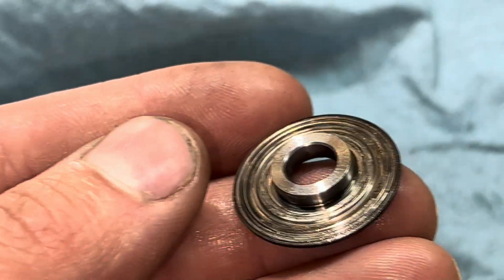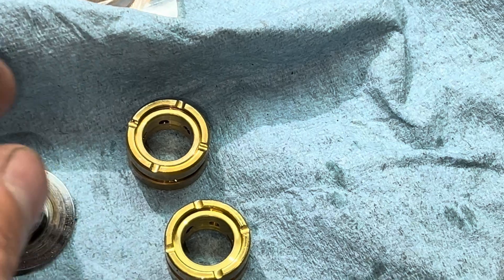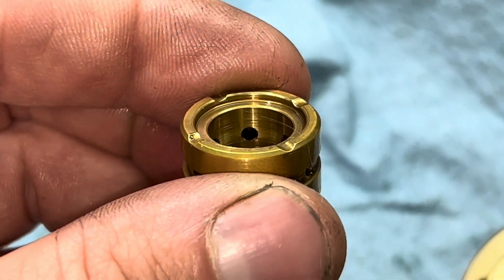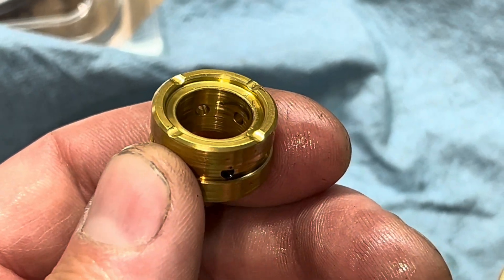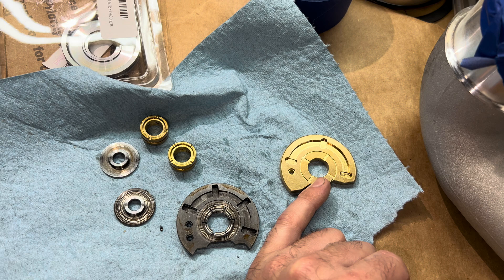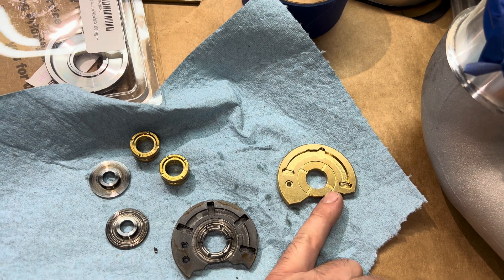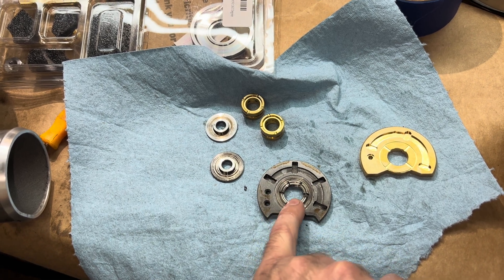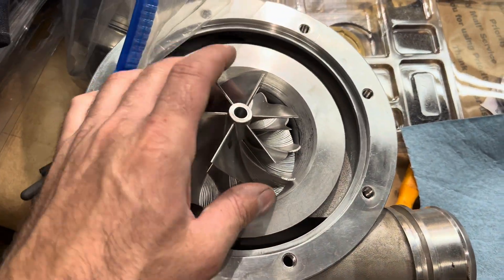See that right there? This is what came out of it, and this is what it should look like — it should just be a flat surface there. The journal bearings were a little bit worn but it really wasn't that bad. I think when this turbo left Force Induction it was just a little bit dirty, because I already rebuilt one of these from the twin turbo set and when it came back the bearings were in perfect shape, which means this guy's oil was not contaminated. So that should have never even happened unless debris went inside those bearings, but that's very unlikely. The damage from this caused the compressor wheel to rub.